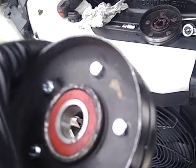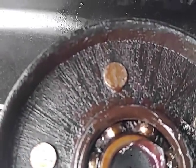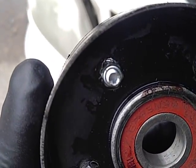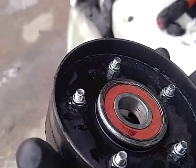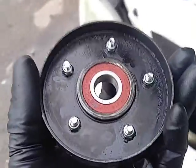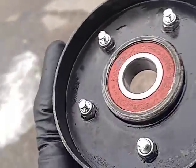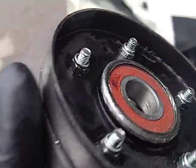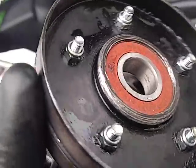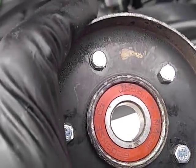I bought a new belt — there's the old one. So I drilled this thing apart, and it's not easy to drill those rivets — they are hardened rivets, think Corvair flywheel rivets. I drilled the rivets, didn't do the best job because you can't stay centered, but I put some bolts in with nylocks and Permatex thread locker and tightened it up real tight. The bearing, which is inside these two halves — if you have a plastic pulley you can't change the bearing because the plastic is molded around it. The bearing came from the Corvair show.